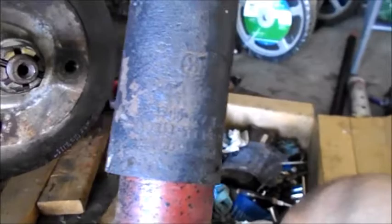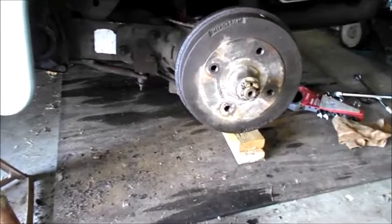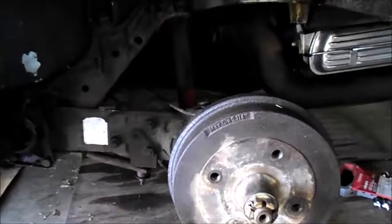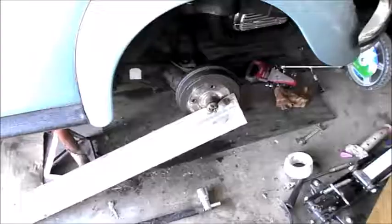Digging through my parts — looking at this shock absorber. I'm pretty sure this is the original shock on the car, 45 years old and it still works. The fender is all tied back in; hopefully it's not lopsided. The guys who painted it didn't do a great job in many places, but they did get the fender beating in pretty well, and I think that looks okay. I think I've got everything torqued down — those four, these three, the sway bar back on, the shock back in. And I don't have any leftover bolts or washers, so that's a good sign.